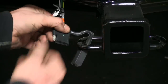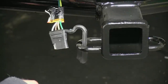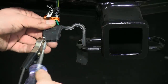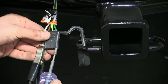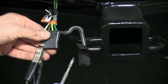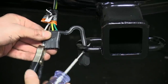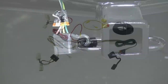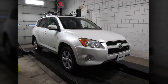Our install is complete. Let's go ahead and test it with a light tester first before we try it on a trailer. We'll connect it to the ground pole, then check the brown wire for running light signal. Next, we'll try the yellow wire — that'll be a left-turn signal — and then the green wire for a right-turn signal. Our brake signal will be a constant signal from both wires at the same time. Looks like everything works, so now it's a good time to try it on a trailer. That'll finish our install of part number 118412 from TowReady on our 2011 Toyota RAV4.